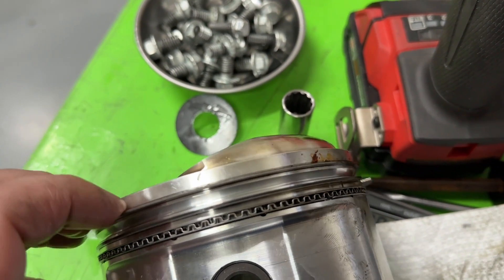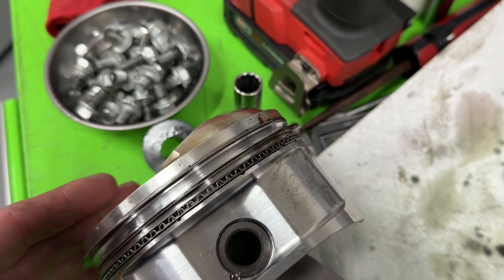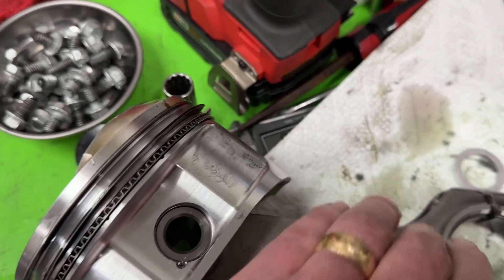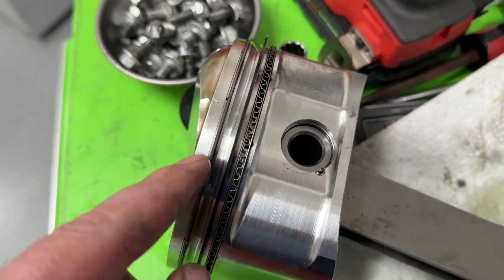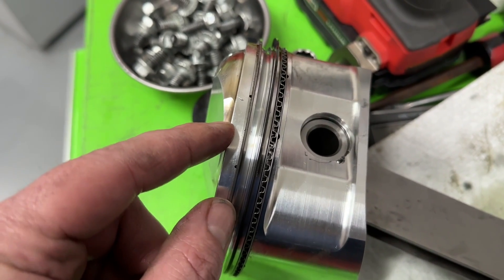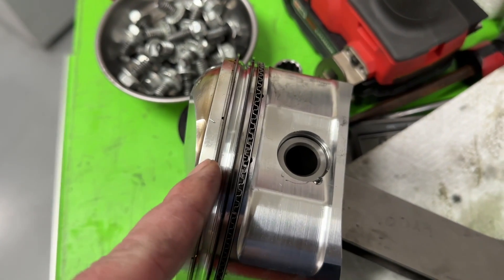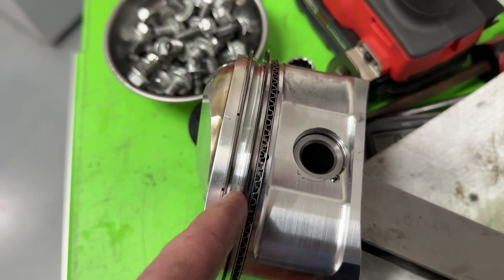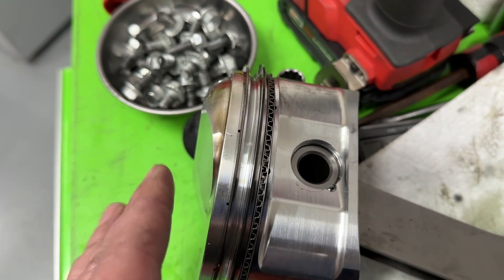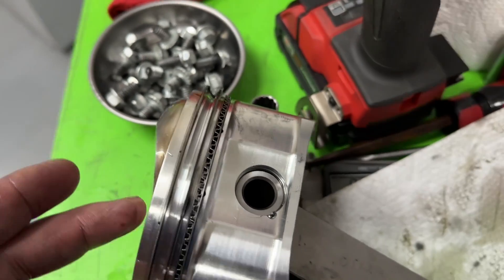This thing really did seal up — it took next to no effort to turn it over. You might say, why aren't you using this for the blower? There are a couple of things wrong with the piston for a blower. This top ring is really close to the crown of the piston. For a blower or any power adder, we move them down to get away from the heat so they don't build up heat and butt and break. The top ring could be moved down. There's such a big oil accumulator groove in the second ring that this could have been shrunk to move it down — but that wasn't done because it was run NA. The higher you have the ring in an NA version, the more power you make. It just makes the piston weaker.